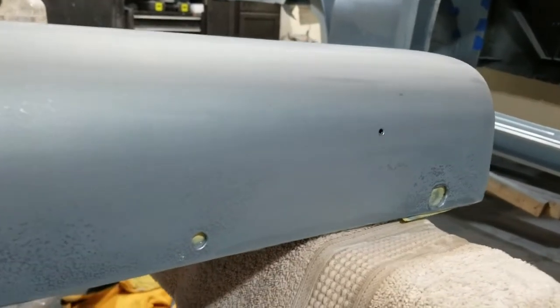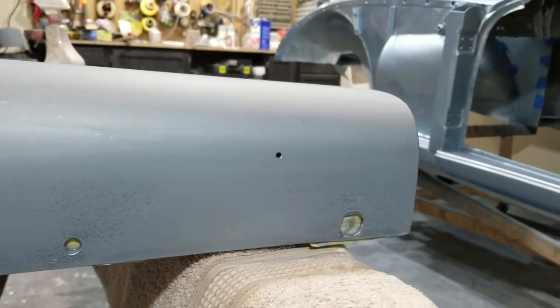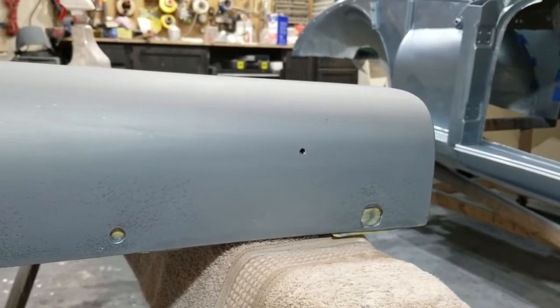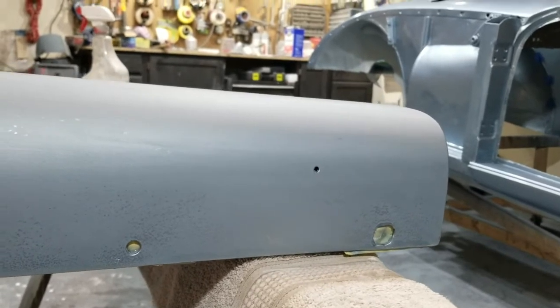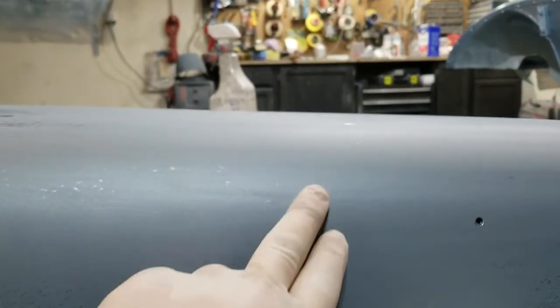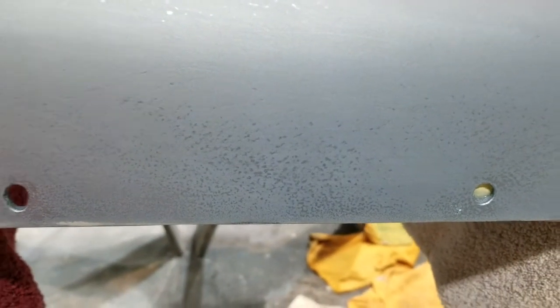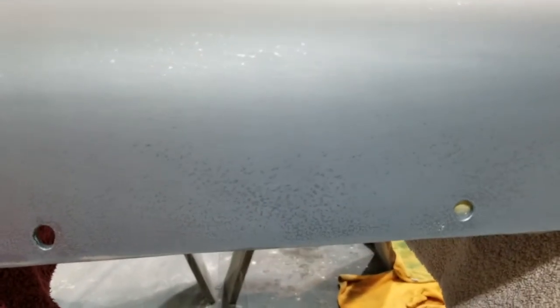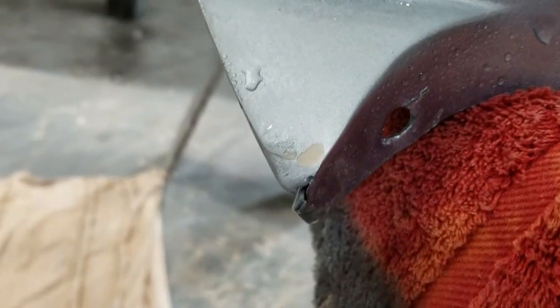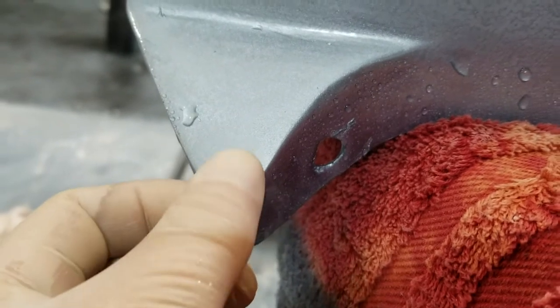Hell yeah! All right, that drip is gone. Both of them. I did a pretty good job on that one. But again, like I say on the other ones, I'm not going to sand down too far. I think I have got down into the paint coat in here, which is okay. And you can see more orange peel here, but again, I'm not going to go any further to fix that. Figures. So I'll repair that. That's a quick and easy repair.